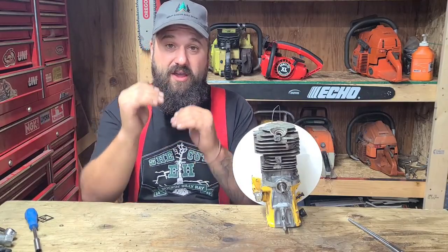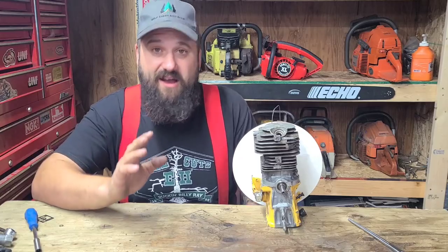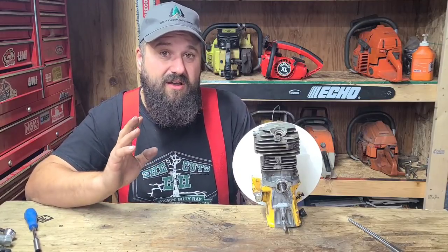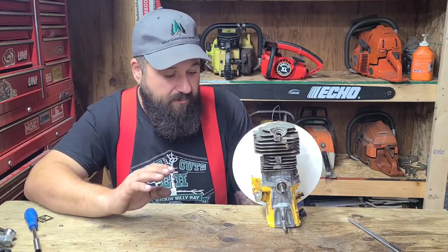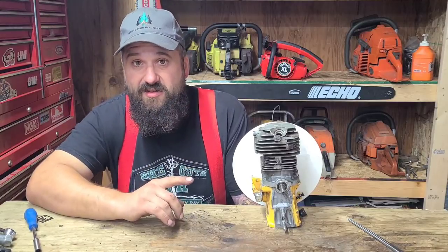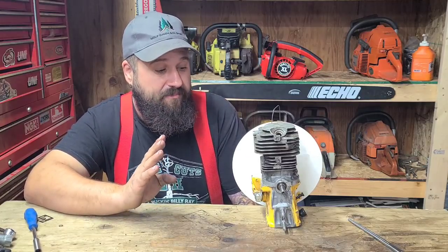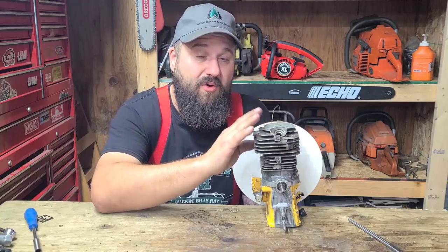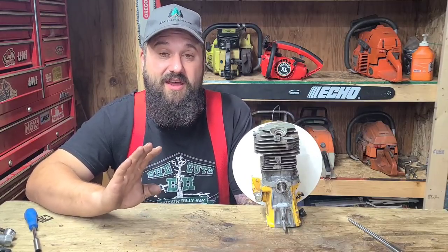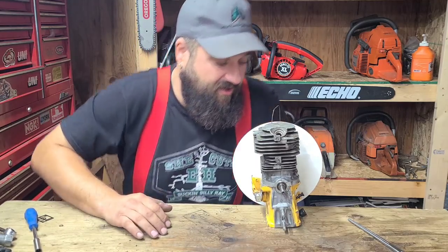Macs are a different animal — they have the transfers that swirl. We're gonna take this all apart and I'm gonna show you again how the Mac system works. I have to take this cylinder off, I'm gonna take it in the house and scrub and wash the whole cylinder with soapy water in the sink. That's a very important step — you want to wash a ported cylinder, or any cylinder. I do this with all cylinders I install; you want to get any honing debris and dirt out of the cylinder.